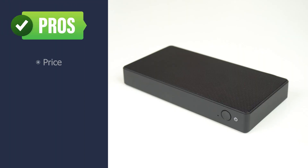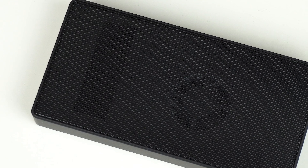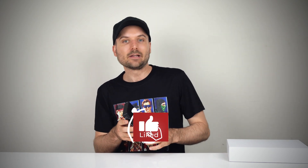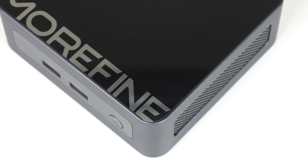Conclusion time. The JX1 mini PC is an interesting budget unit that does a lot of things right but also stumbles on the home stretch. The price is decent for what you get, and upgrading storage is inexpensive. It's powered by USB-C, and overall the port selection is pretty good for a budget mini PC. However, it's got soldered memory running in single channel mode, and performance overall isn't great — in fact, it was the lowest N5105 performer in almost every benchmark. If the performance was as good as the others, I'd be happy to recommend it, but as it is, it's just okay. These budget minis have their place and are still relevant for various low-powered computing scenarios. But if you want a budget PC with a bit more hutzpah, check out the latest generation Intel N100 mini PC review — it's a large leap in CPU performance, and there will be plenty more units coming out this year.